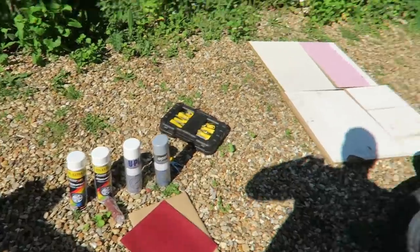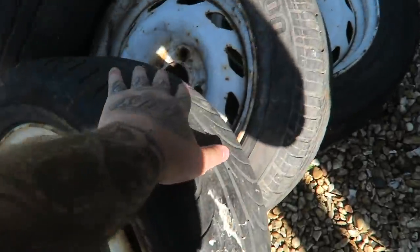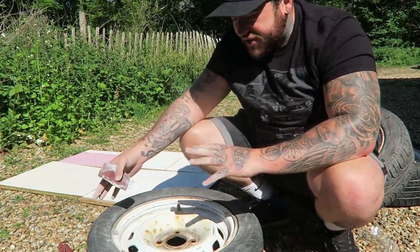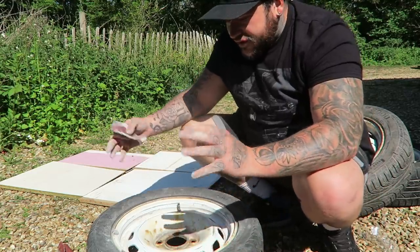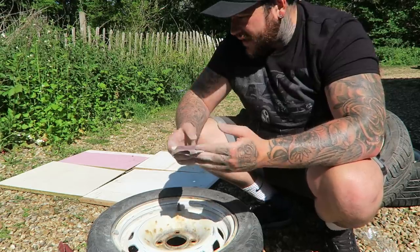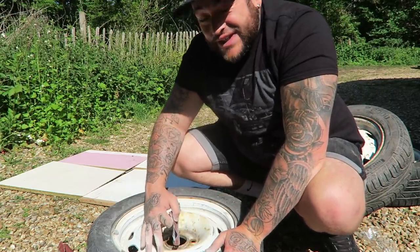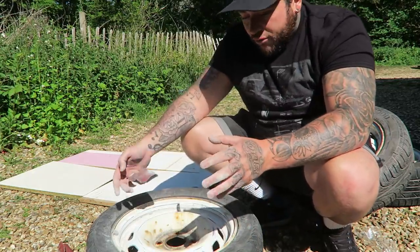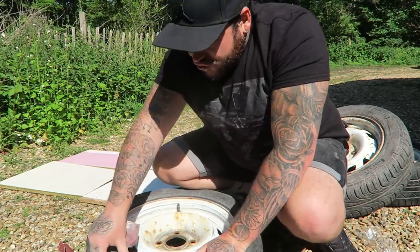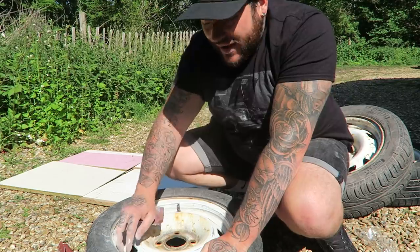I think there's a good amount of sanding and fettling needed to get a good finish off them to start with. We're going to start by sanding them back and see how bad they are. I've started to sand the first one down with 120 grit sandpaper - that's giving quite a good smooth surface and getting all the rusty horribleness off the faces. I've also let the air out of this one just to try and get into all the grooves around the rim.